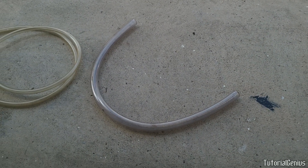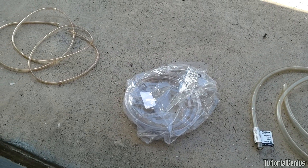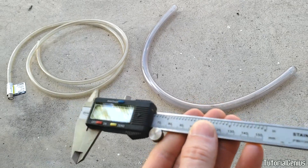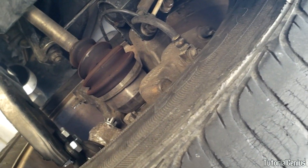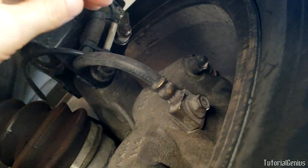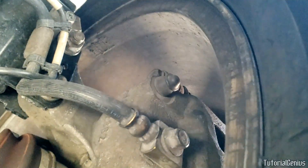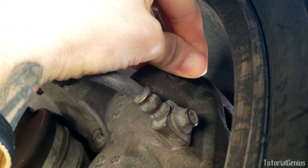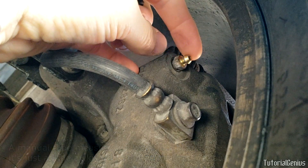All the tools I'll link in the description below, but what's unique to you is the width of the tube in order to set up your brake bleeder. How do you know what width to use? Number one, resort to your service manual, however some of them don't state that. So number two, we're actually going to measure the nipple on the brake caliper to determine the inside diameter of the tube we need. Disc brakes, drum brakes, it doesn't matter — you might want to ensure that your rear and front nipples are the same size.